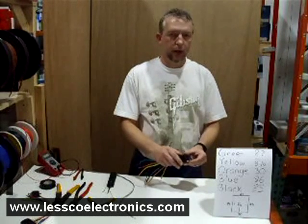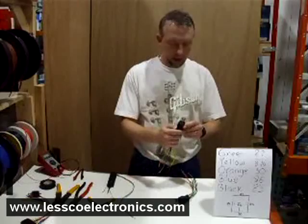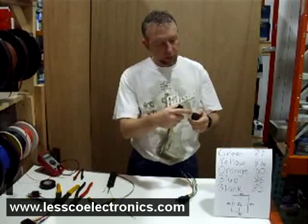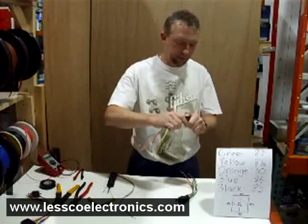In this clip I'm going to show you how to wire up five-wire door locking systems with two relays. Here I have two standard single pole double throw relays with five pins on the bottom, and I'm also using an Omega 5-wire relay socket.